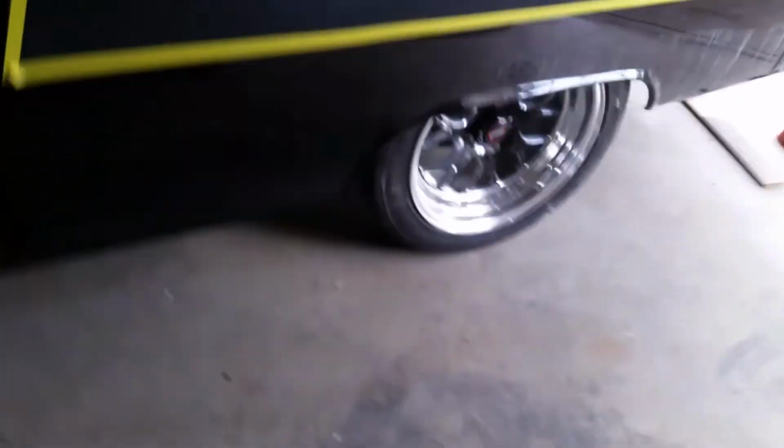So what I did to mask it off, which most people don't really care, but I do have a couple of subscribers that would be curious. So I've got my plastic here, and I had it over the car, and it's all stuck together, and I can't do it with one hand, but anyway, I basically just cut this area out of the plastic after I layered the plastic all over the car, and then I back taped it. And back taping is where you lay your masking tape down, and then you roll up one whole side of it and fold it over. That way it's rolled in, and when you're concentrating on one area, your overspray doesn't make a hard edge. Like this is not a hard edge around here, which just makes it a little easier to sand. And that's what's referred to as back taping.